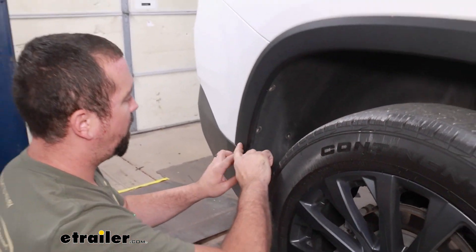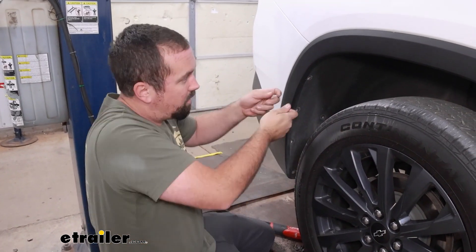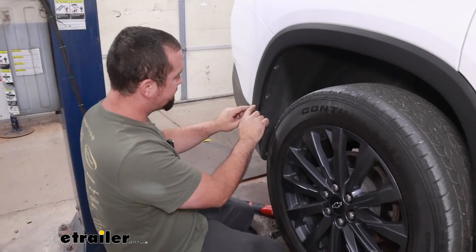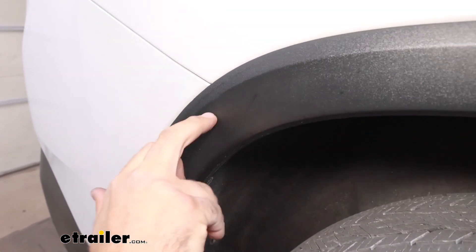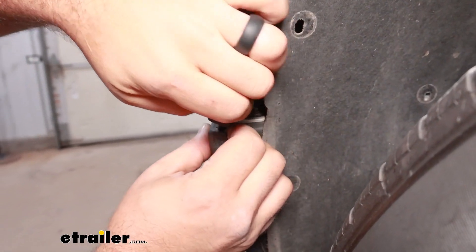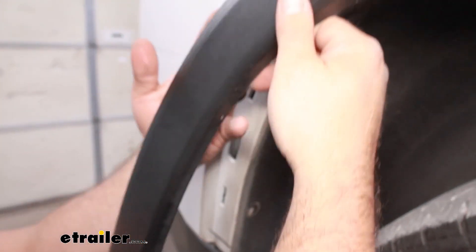With those removed, we're going to pull back the fender trim. Be careful not to peel it back too far because it can cause a permanent crease. Take your time — there's a series of clips but we're bringing it back just to where we have hardware located to get the face off. There's a plastic tab that goes into the bottom; just pull back a little bit to get that out and it should pop off pretty easily.